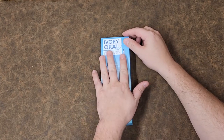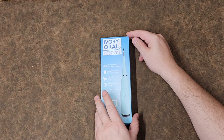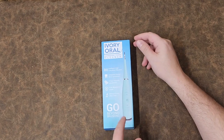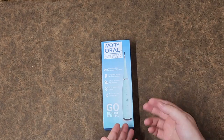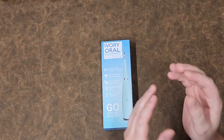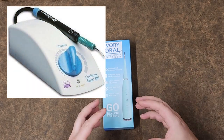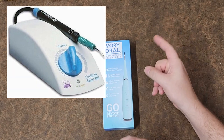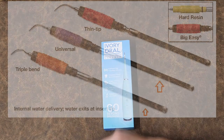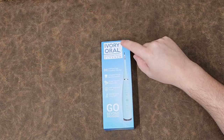This is an ultrasonic tooth cleaner, which all the advertisements sell as the equivalent of an ultrasonic prophylaxis. Obviously this is not going to be an ultrasonic prophylaxis. For one thing, there's no harmonic generator. A real ultrasonic prophylaxis has a tuned needle — an insert that goes into a pen — and a harmonic generator which induces an RF frequency vibrating the tip at a very particular frequency: 25k, 30k, 35k — there's a spectrum of frequencies.